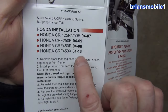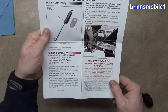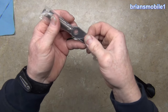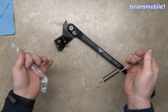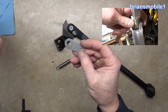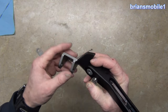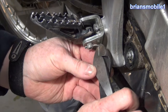This particular model basically fits a whole bunch of different bikes. The bike we're doing is a 2008 450R, so that's right on the fringe of what it fits. There are three parts basically: the kickstand assembly, a little bracket for the spring, and the spring. No bolts included - because it uses all factory bolts. This recycles the bolt for your subframe and the two bolts that hold your foot peg on, and this bracket replaces the factory bracket.